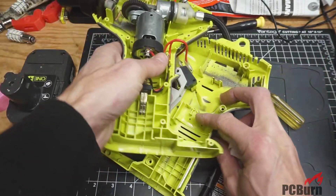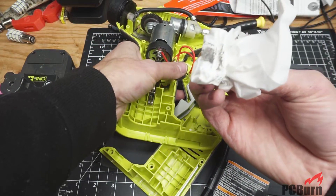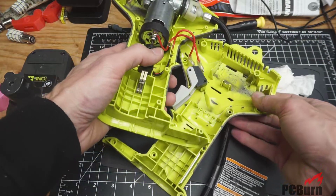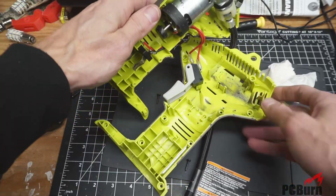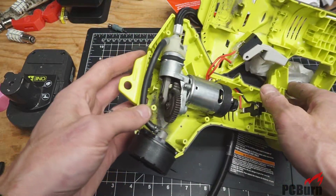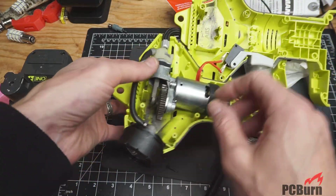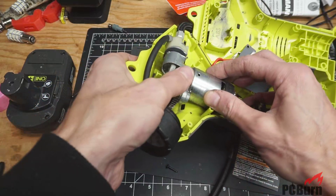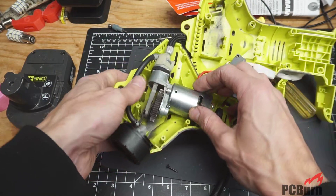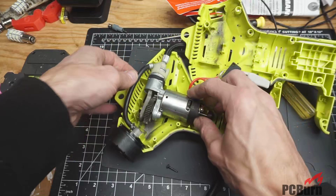Let's see what else we can find in here, aside from losing all the screws immediately. That's a mixture of grease and metal shavings. Curious where the metal shavings are coming from — that doesn't look like it's just coming in from the outside. Well, that does look like molybdenum grease. And I'm not sure where the metal's coming from. The piston actually looks okay, but I'll probably have to dig a little more into here to see if that's the case.